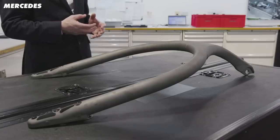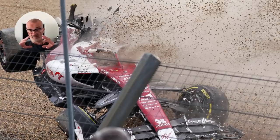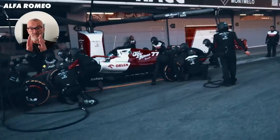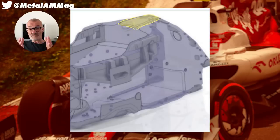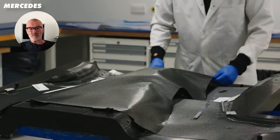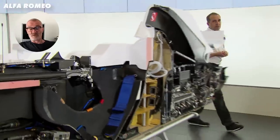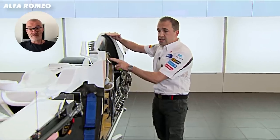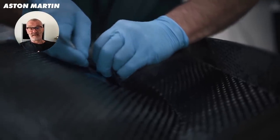What failed — did the roll hoop grind down or snap? Some people think it literally ground away in the accident, but that's not the case — it did break off. Some thought the blade metal roll hoop itself failed, but pictures show that the metal part of the roll hoop was all in one piece, with jagged carbon fibre extending from the side of it. The roll hoop is bonded with a big flat surface onto the top of the monocoque with very special adhesive. What actually failed was the carbon fibre in the monocoque — it looks like a layer of carbon fibre ripped off, delaminated, and went away with the roll hoop.